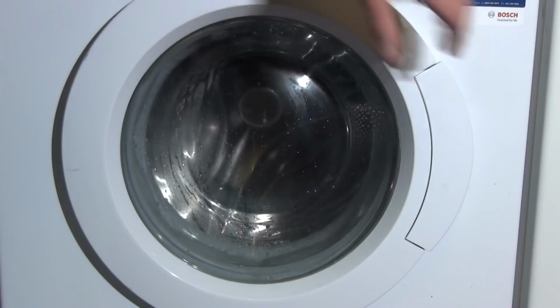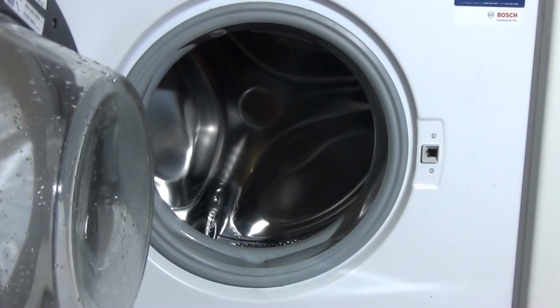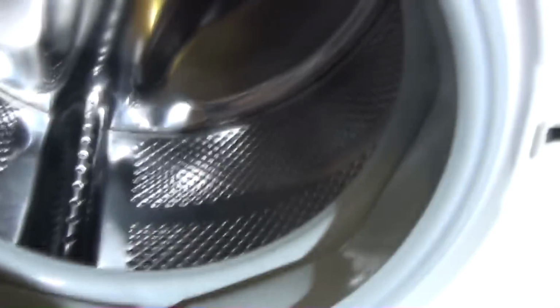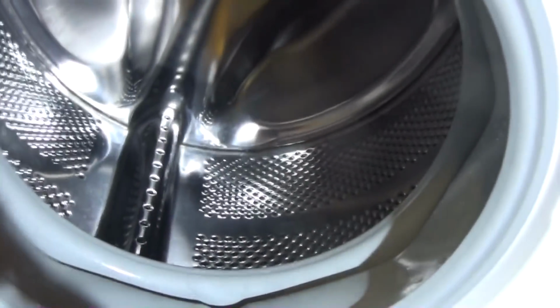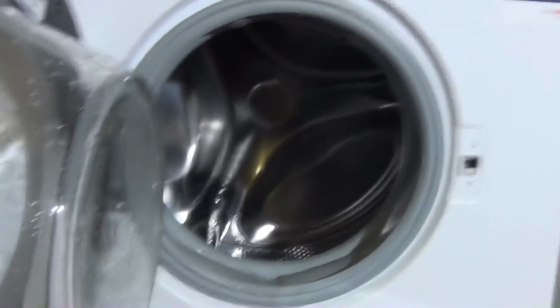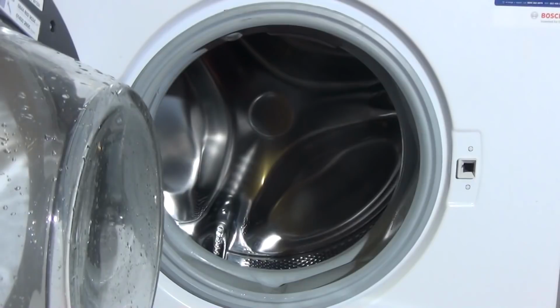At the bottom here we've got our coin filter trap, fluff trap, which is just a simple push down on that and it's hidden away there. You can also drain it, and there's an emergency unlock release under there as well. So inside, the door gasket hasn't changed, and that drum hasn't even changed design either, apart from the fact that at the back the hole's been filled in and it is actually slightly deeper, hence why you now get 7 kilos, albeit that you might have only gained about 2 litres of drum room.